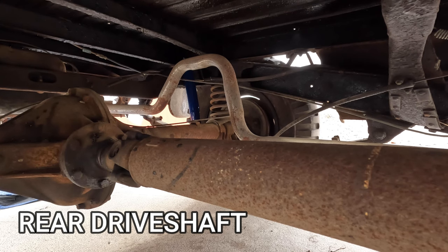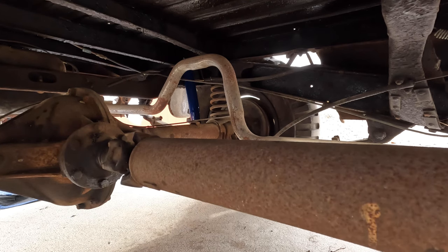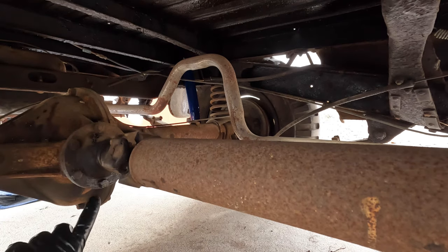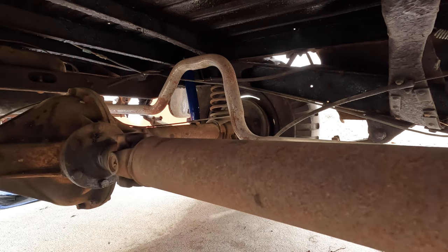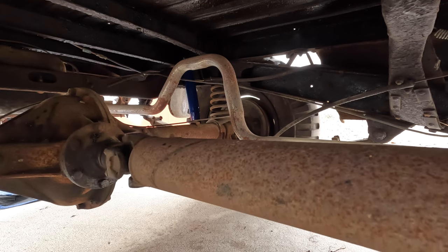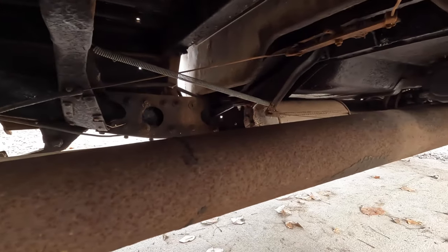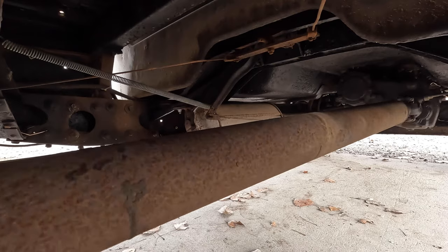Now we're going to take a look at the drive shafts. This is the rear section of the rear drive shaft. I've got one of the rear wheels jacked up. I can spin the wheel with my hand and we can get a look at this drive shaft as it rotates. Good news right off the bat is that we don't have a bunch of leakage coming from here, so that means that seal is still doing what it should be doing. The U-joint seems to be alright. Now let's go ahead and rotate this around a little bit, we're just looking in here for cracks and failures. Looks okay there. Let's point it towards the front of the truck now and look that direction. It all seems to be alright.